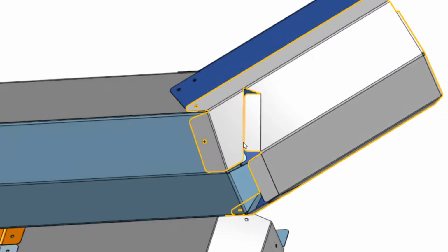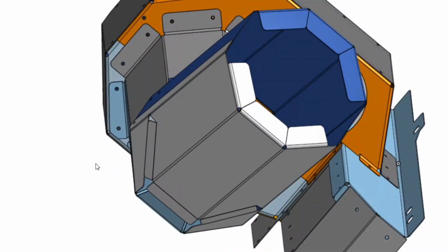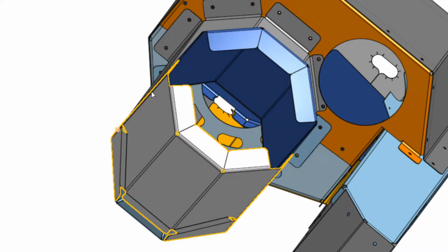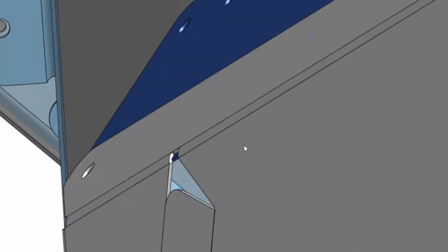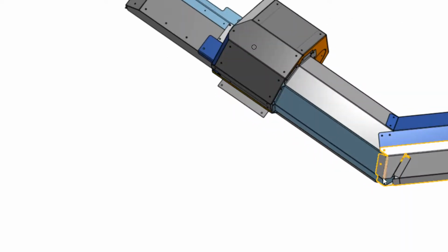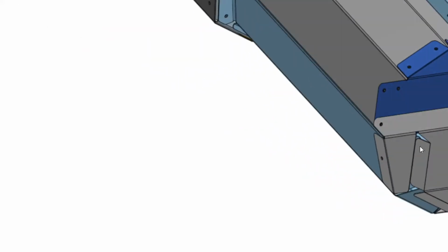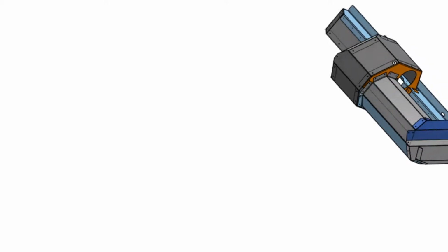We're going to lose some air around here that's coming down the pipe through those holes that were in the back here, and let's see if we can see any of those. There you can see a couple of the holes back in there where air comes through the side wall around the exhaust turbine and then can funnel into this space and come up along the exhaust pipe. We're going to lose some of that air in the gaps around here, but if you can bend these flanges in place, it will force the last bit of air to flow up along the last part of the exhaust pipe and come out here where it meets the muffler.